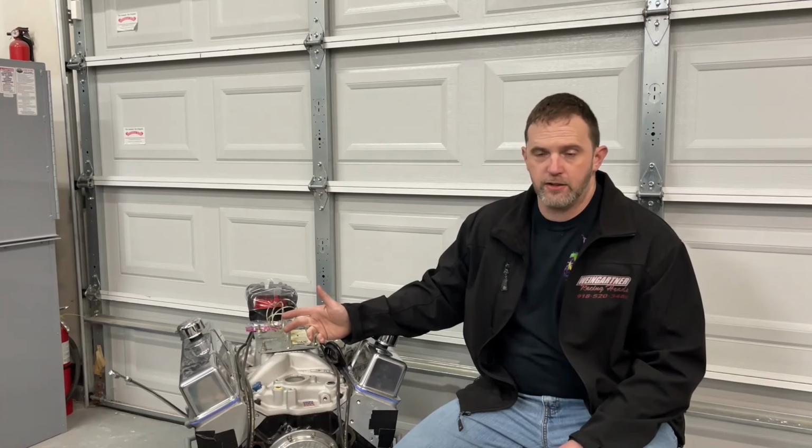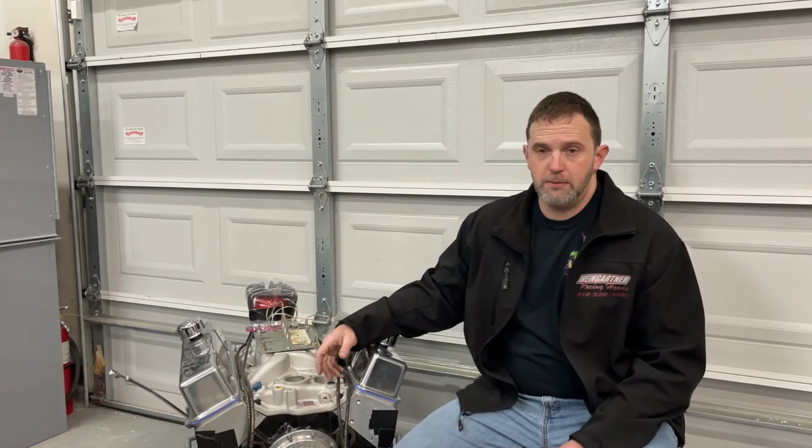Now, I know you're thinking, well, aren't you going to creep up on it? Aren't you going to start with like 32 and work your way up? Well, I figured, must be God talking to me or something to get it right there at 36. Because that never happens. Usually you're off and you've got to turn the distributor. That'll fire up, but it isn't close enough or perfect timing. This seemed about right, so I figured, go with it.